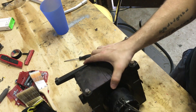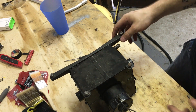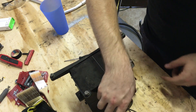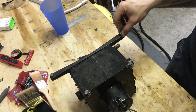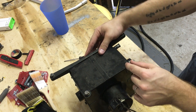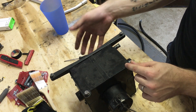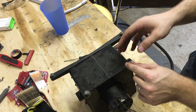The way this sits in your car, it sits underneath your dash in this orientation. This side right here — the one with the fan motor pointing out — is what actually faces forward towards you and your passengers. And the core actually sits on the back side up close to the firewall. What that does is it prevents your feet from getting burned on the heater core, because it runs really, really hot, even when you're not using your heater.